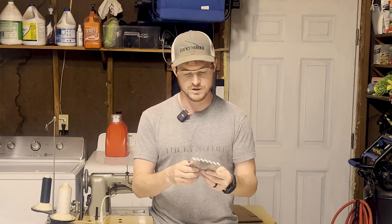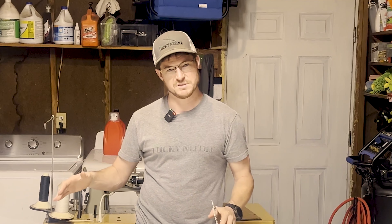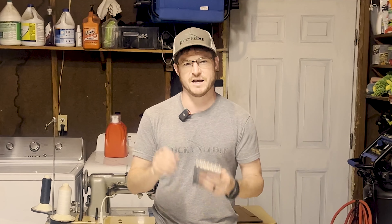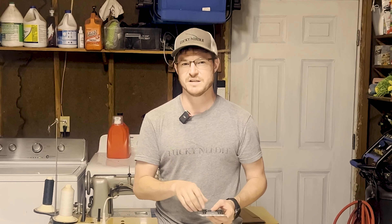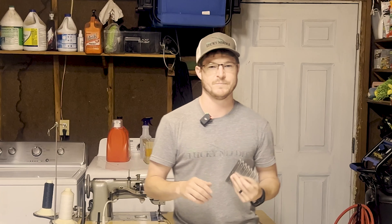The tool is called a point-to-point tool and it's from a company called mpower. Essentially it's this little accordion that allows you to lay out points equidistant from each other, saving you a ton of time instead of measuring everything out and calculating where all your points need to be. I'm going to show you about three key ways I use this — I think every trimmer should have one of these in their toolbox.